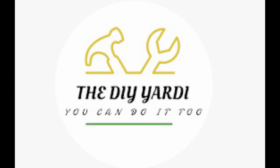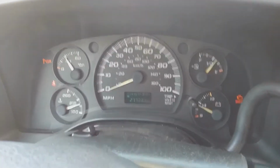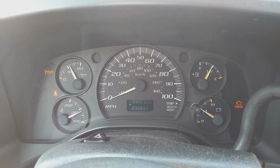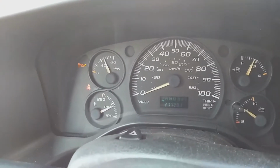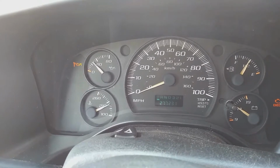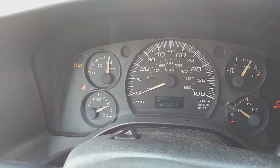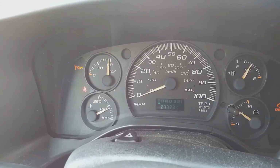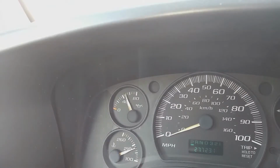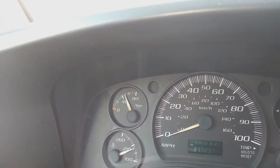In this video today, I'm working on a 2003 Chevy 2500. It's a cargo van. And the issue is the oil pressure gauge fluctuates between 40 pounds, 80 pounds, and zero at times while driving. Sometimes it will sit on zero pressure and periodically jump back up to 40 or 80. But basically, after checking this car out, I came to the determination that it needs a new oil pressure sensor.